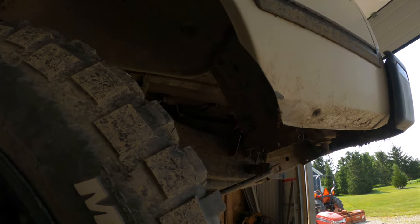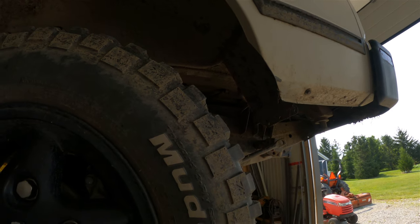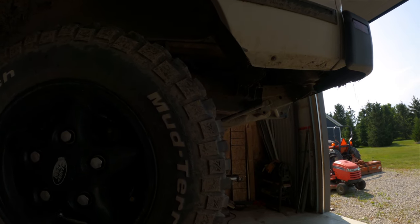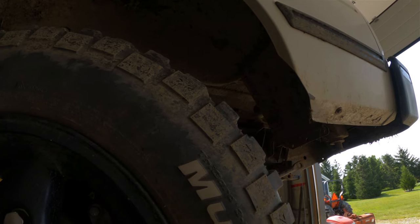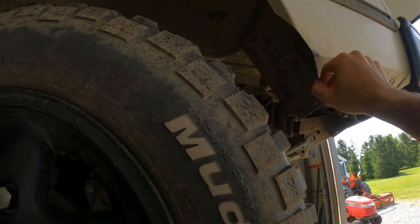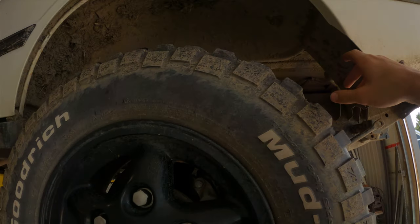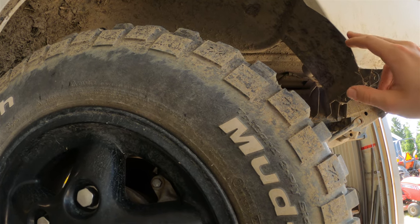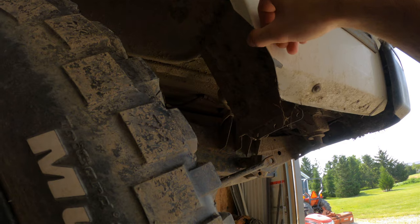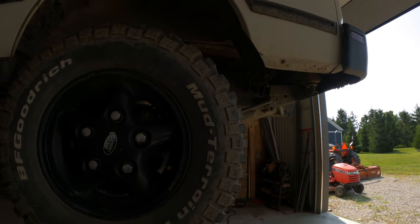I originally cut about an inch off of it because I had bump tested it to that. But then I took it off-road and tested it again and it bumped backwards a little bit. Not really sure why, maybe just some play in the suspension or the angle I was at. But it ended up rubbing and it bent up some of the aluminum, so I had to cut it back a little bit further. When you do that, make sure you sand it really good, round off the edges so your tires don't rub and cut into your tire.